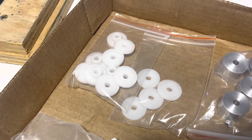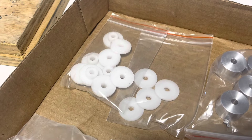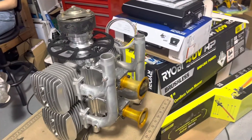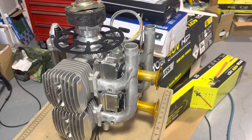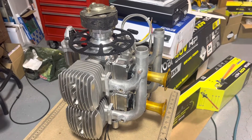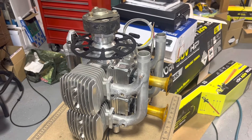The Delrin shoulder washers ensure I don't have metal-to-metal contact with the way the motor mounts. The bolts will go through but the Delrin will keep it isolated from the aluminum so the engine doesn't vibrate problems into the motor mount. That's my work for the weekend — I'll be back posting something this week. Cause to be excited about the BD5 project? I do. See you all soon.